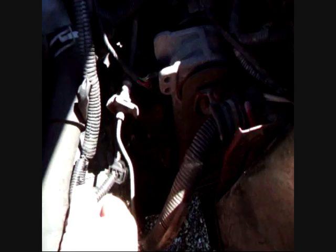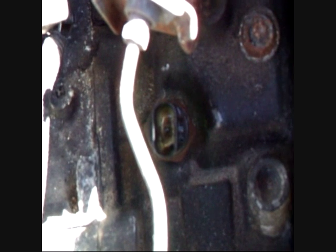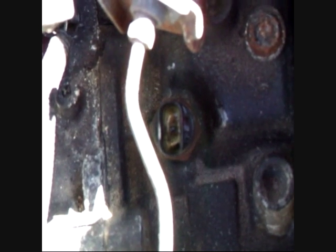Just, you see the pipe that goes to the clutch slave cylinder. Well, the switch is there. The light's not very good actually, but anyway. At the side of the switch there's a push-in bit. So you squeeze it and pull the plug off. Set it to the side, out of your way. And now you can see the switch. Wait a minute, can you see the switch? Focus in the camera. There you go. You can see it. Not brilliant, but you can see it.